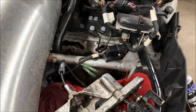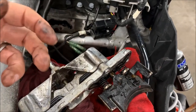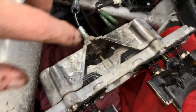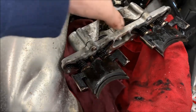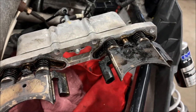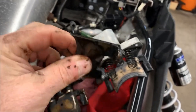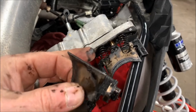The power valve assembly has been removed. In the event that it's sticking to the cylinders, just grab a set of channel locks and gently grab the assembly and rock it back and forth — eventually it will separate and you'll be able to pull it out. Now with it out, first thing you want to do is make sure the cable is still there and isn't broken — this one is still in pretty good shape. This is the power valve assembly; it's actually a little different in design than what you're used to typically seeing — it's kind of a two-stage setup. In the event that it comes apart during removal, don't freak out — it's supposed to. That blade comes right out and just goes back on those springs.